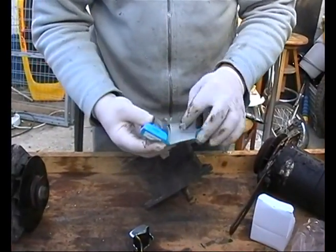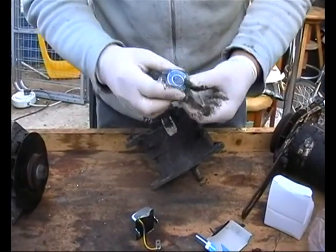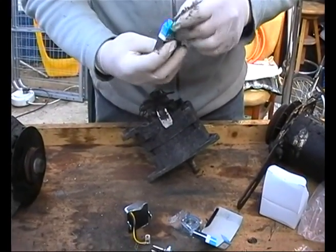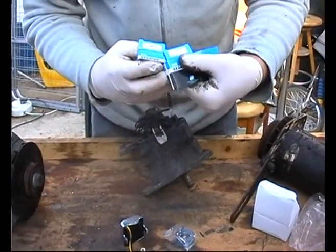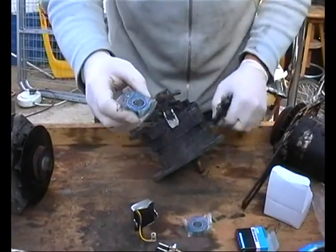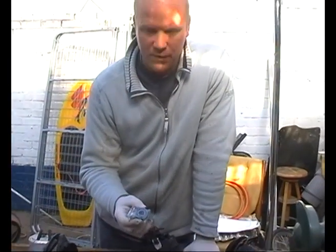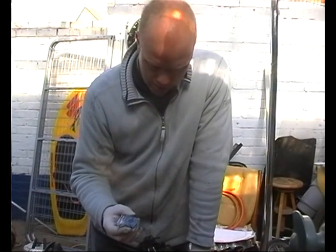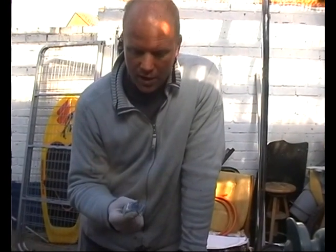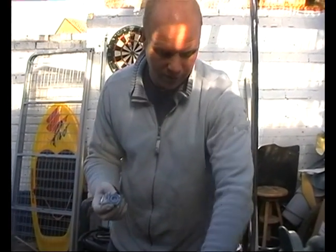Bearings — on this one they're two the same, I think. Same part number? Yep, 6202. And these bearings are so cheap, about £2.50 I think these ones are. This is the sort of thing that goes in washing machines, tumble dryers, anything with spinning parts. They're very, very cheap to replace — useful to know if you've got a noisy washing machine or anything like that as well.